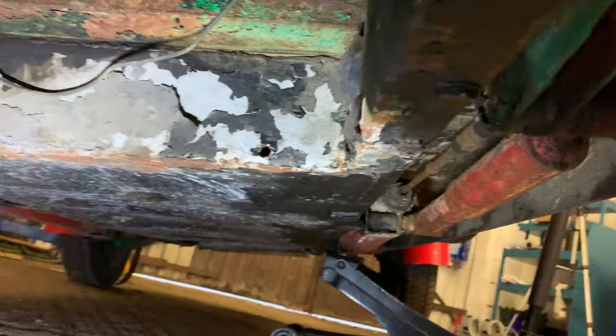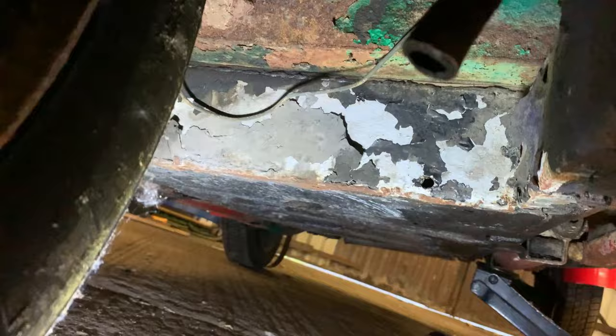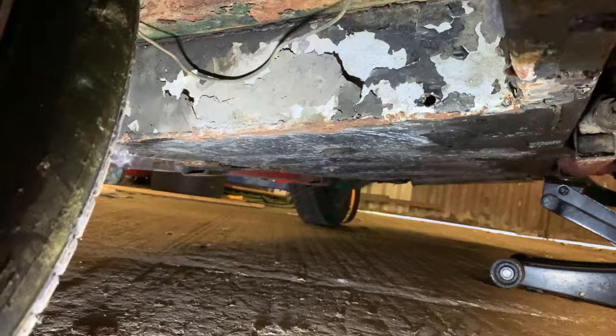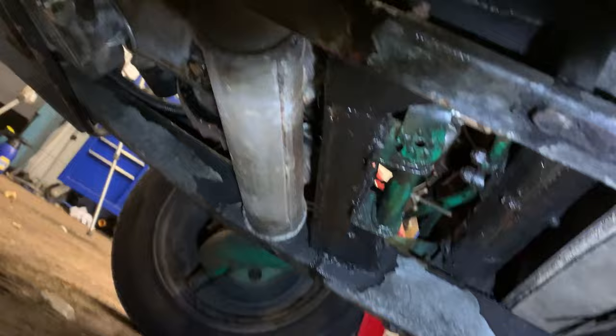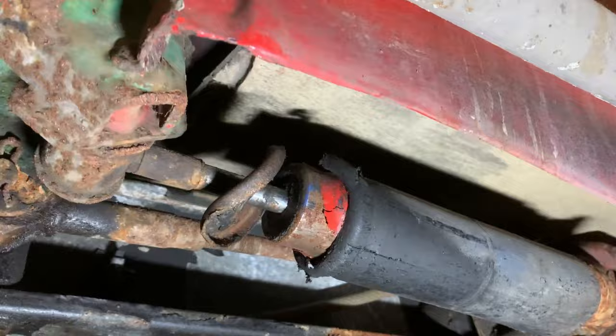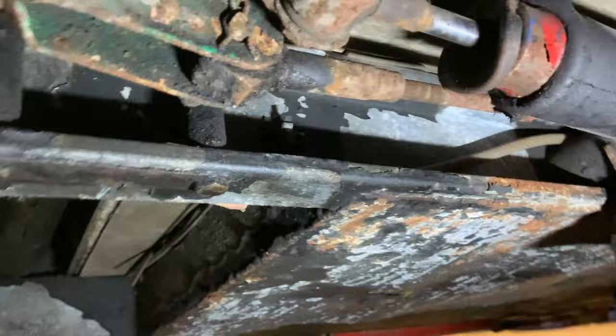Let's have a look at the other side. That oil leak is still there - I think it's the sump plug for the front engine and this one's the gearbox. I mean you kind of want a little bit of an oil leak, you need some underseal under there. This one I've looked at before - this shock absorber device looks pretty much goosed, so we'll definitely replace these.